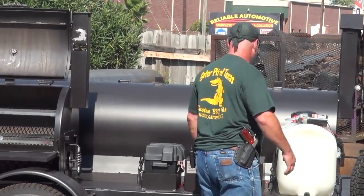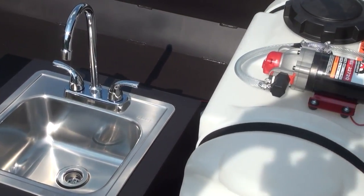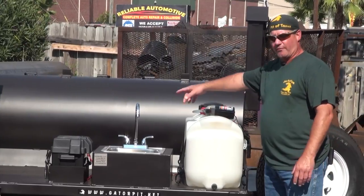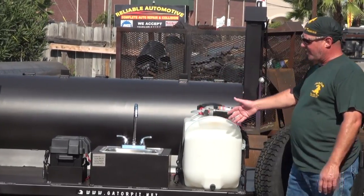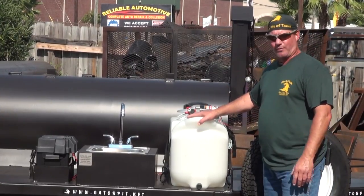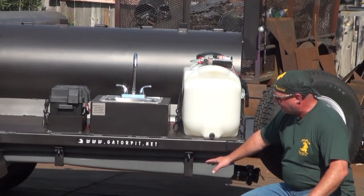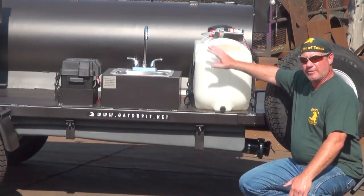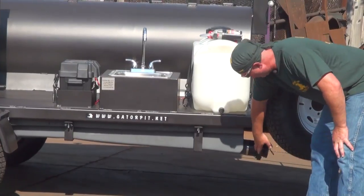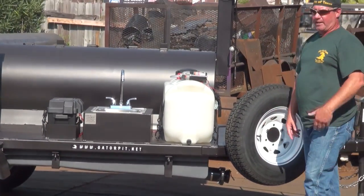On this side here, you've got a single bay sink, stainless steel, boxed in. You've got your RV marine battery that operates the pump, which is a diaphragm pump — it only kicks on when you turn the valve on for the water. Absent that, it's not using any power, so it's not draining your battery. You've got 25 or 26 gallons of fresh water here. When it runs into that sink, it goes into an RV dirty water tank down below. You also have an RV drain valve — pull the handle and it drains your dirty water tank. You can hook a hose up to it and drain it at a commissary.